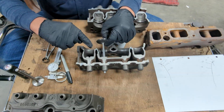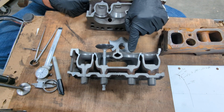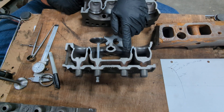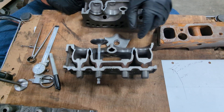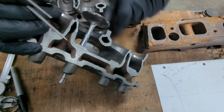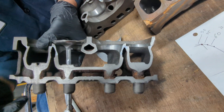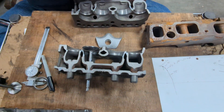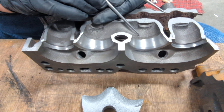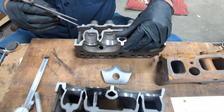Hopefully that answers some questions. It's critical that you don't hit water in your ports when doing your throat cuts. So: the 30, 45, 60 for a certain width of 100 to 150 thousandths, and then a 75-degree cut. Do not come in with anything steeper than that because it just takes excess metal away. Then you can hand port this head — you smooth this area out with your carbide air-powered or electric-powered tool on both sides. You have air trying to flow along this wall, so just take that little bit right there and smooth it out on both sides.